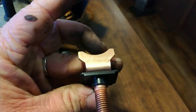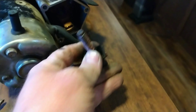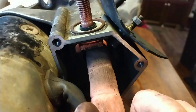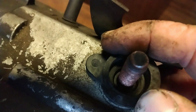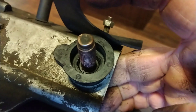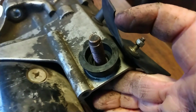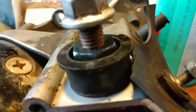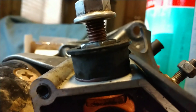This tab in here — it's thicker on one side than it is on the other side. The thin side goes right here where these ears are, slides right in there and you snug that down where it just slides into place. There's also an o-ring that goes over here, so check that out — if it's broken, replace it. Copper is pretty soft so this stud will press into there pretty easy just by torquing that bolt — that's 17 millimeter.